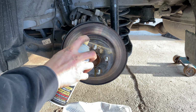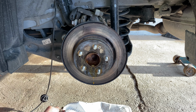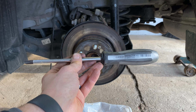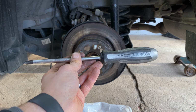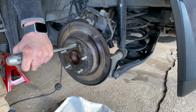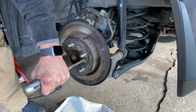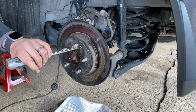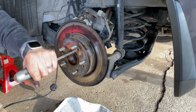Using penetrating oil, spray the rotor mounting screw, the bolts on the hub, and around the center hub. To remove the rotor mounting screw, avoiding damage to the screw, you will need a special JIS Japanese Industrial Standard PH3 hammering screwdriver, which I will link below. Using a sledgehammer, repeatedly strike the hammering screwdriver with malice until it releases. If you damage it, this part is not required, serving no structural purpose, and could be drilled out in situations of severe rust.